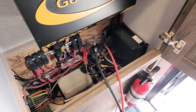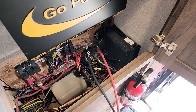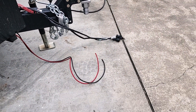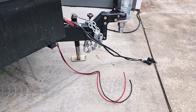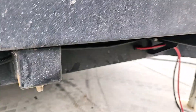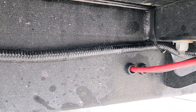I have the cable run into the trailer, drilled holes in the frame — two sections of it — and I have it out to the tongue of the trailer. Let me show you that outside. Here are the wires before I put covering on them, the Anderson connectors and all of that. I'm going to leave that for now until I get the truck done, then we'll see how this all mates up. But I wanted to show you the grommets that I used here — it involves drilling a half-inch hole and then running the wire through the grommets.